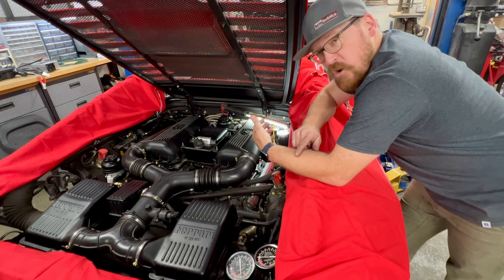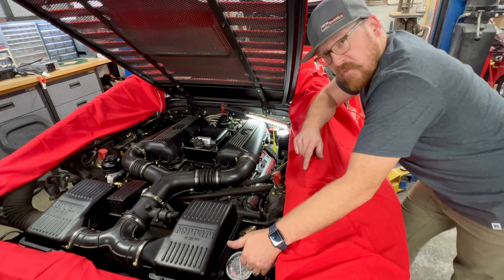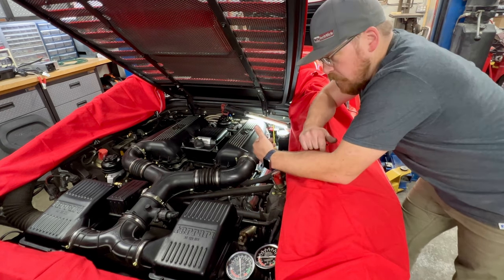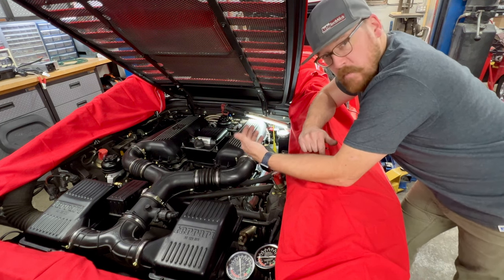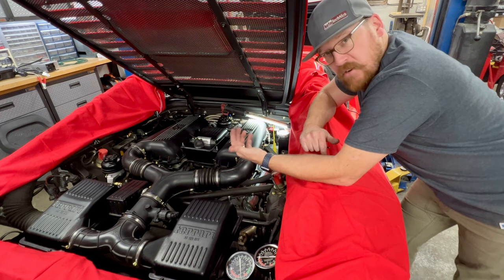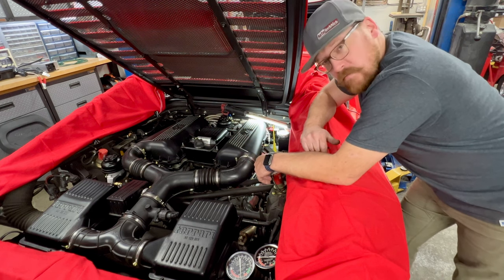So we don't really know what the cause was. Was that fuse blown because the control valve vacuum hose was off? Or was that hose off because the fuse was blown? Not sure. We're just going to leave the system as is and advise the client. We'll run the car a few more times while we have it here, make sure that there's no other problems with it. But really, right now, it doesn't warrant any further investigation. So that is definitely nice.